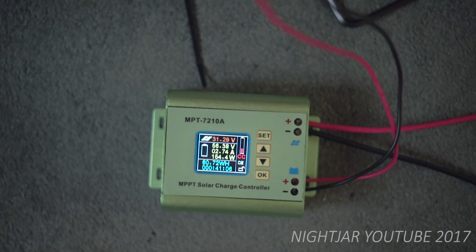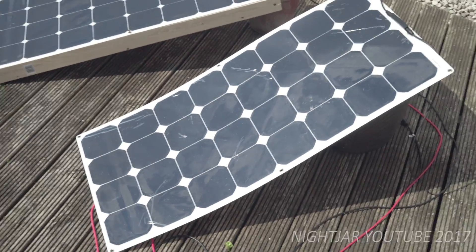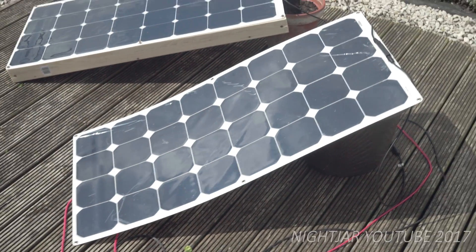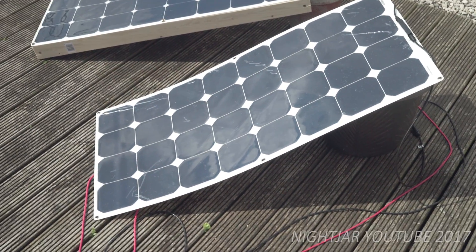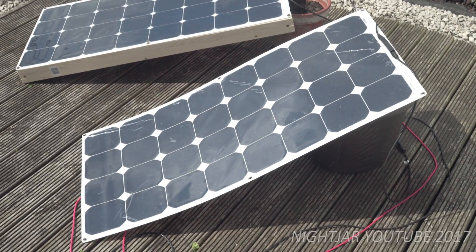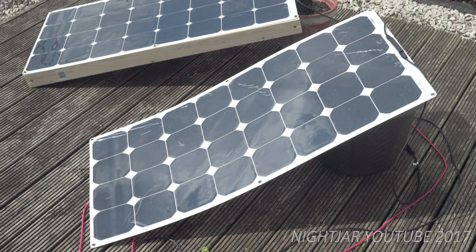It's quite interesting to see how well these panels do. It's SunPower that make these cells — these are about the most efficient cells you can buy on the consumer market. These flexible panels are good quality and come from AliExpress, pretty fairly priced, so these are probably the low end of those cells, but still pretty good. These panels are only about three to four millimetres thick as well, so the goal is to get it really rigid on the bike, and as long as you've only got that three to four millimetre front section facing the wind, it won't actually produce much drag. Another bonus is that the air going over and under the panel is going to keep the panel cool, and it's probably going to produce more power because solar panels don't like being hot. They always come rated with a coefficient, so you can calculate how the increase in temperature reduces the efficiency. So it's got potential to be pretty good.